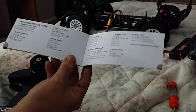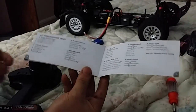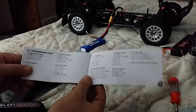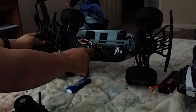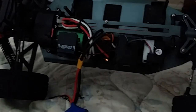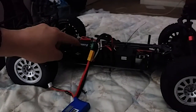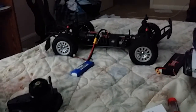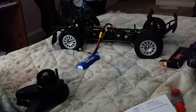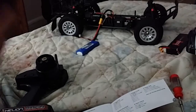It's not hard to manually set it. It's nice to be able to do this at the track without taking a computer. I am going to get the Castle Link so I can set my throttle and brake curve and make more minute adjustments. But out of the box, this is a damn good motor and damn good ESC. The SV3 version actually comes with a fan on the ESC because so many people complained about the first and second version overheating and going into thermal shutdown. There's also a fan on the motor itself — you just plug those into the receiver ports for power.